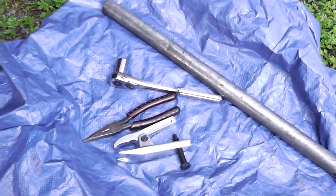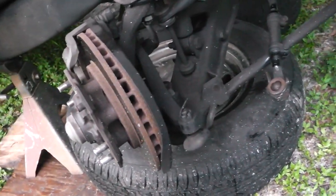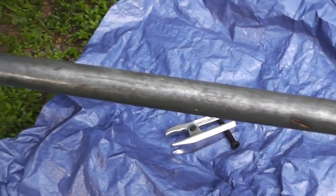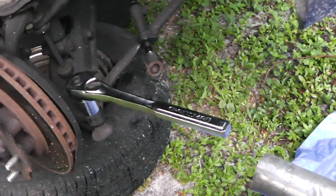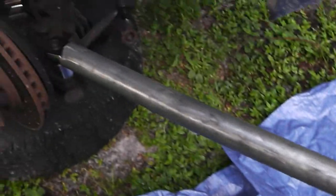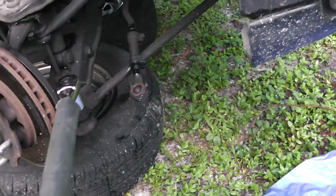I've got a few tools right there. You can see this is where it came apart. So let's get that pulled out of there and get down to it. One of my tricks here is if you don't have enough oomph to undo these bolts right here, you can just put this little extension on here — this is just a piece of inch-and-a-quarter EMT pipe — and if you come over here it makes it really easy, of course you've got to have something to anchor it to.